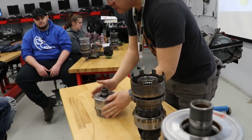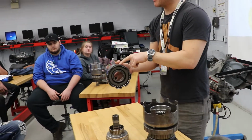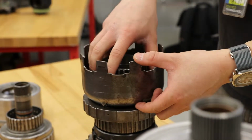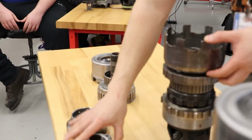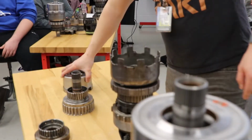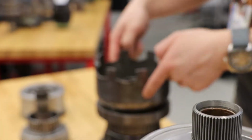Torque now leaves the direct clutch shell and transfers into these lugs. These lugs then send torque into the common sun drive shell. Right now, your forward ring gear is not part of the equation. No torque goes into that. Your carrier, though it is spinning, same thing, no torque goes into that. Those are out of the picture for the power flow. Power flow gets sent from the lugs of the direct clutch into the lugs of your common sun drive shell. Torque goes into the drive shell.